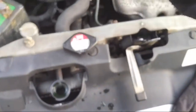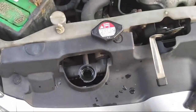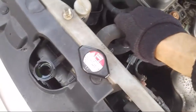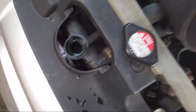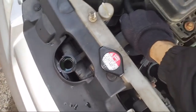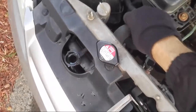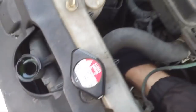Put my glove on. Even though I filled this up earlier, you see it goes down and the air gets out or something. This is kind of warm, so squeeze the radiator hose to help get some of that air out of there. You can see it coming out. Try not to breathe those fumes in. Squeeze that one down there too.